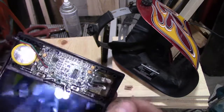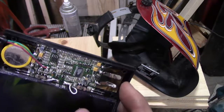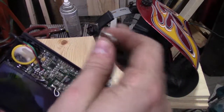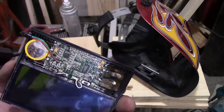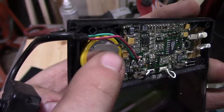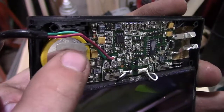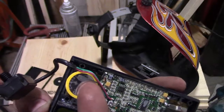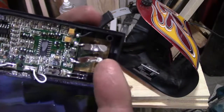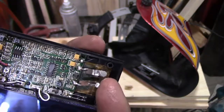Other places tell you that you need to clip these little contacts and solder in a new wire, with an external little battery holder hanging out. But this is a free option. These little batteries — you can see there are only two little tiny places where they were resistance-welded. If you get a screwdriver up underneath this tab and work that little weld, it'll eventually just pop clean off. Do that to both sides and now you have these two contacts.